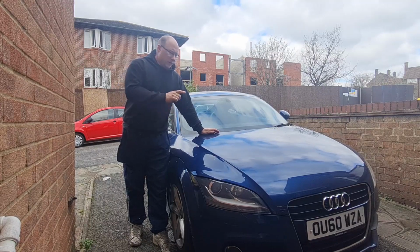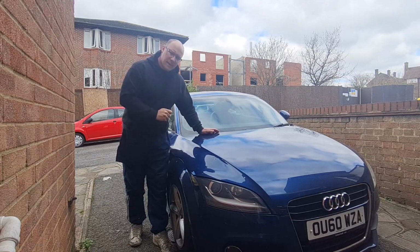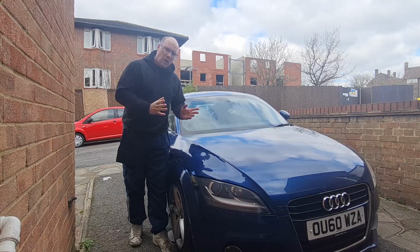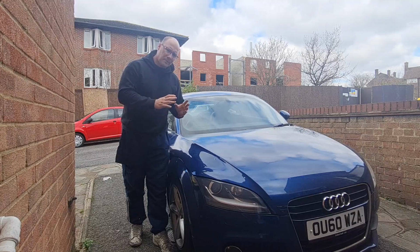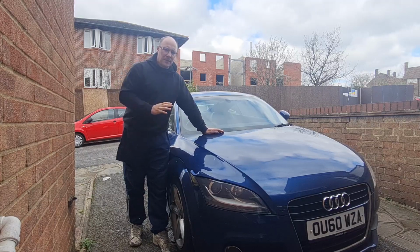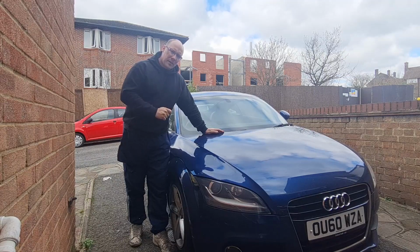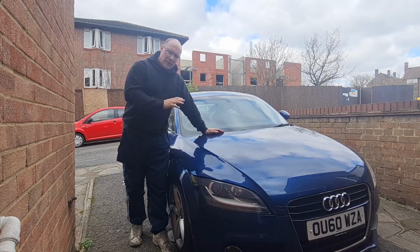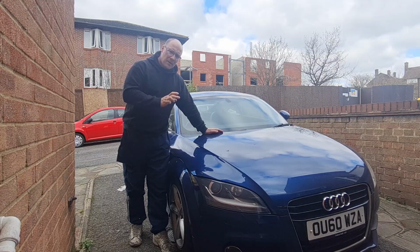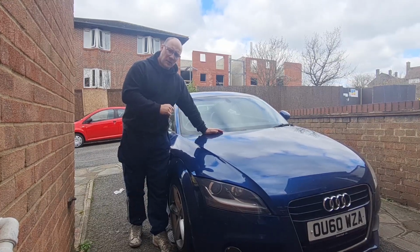Now I've had a look at it and I've actually taken the PCV valve, which is a positive crank ventilation valve, apart. I've cleaned the whole thing out and I have looked inside it. It's got a rubber diaphragm inside it, and it was all clogged up inside and the diaphragm is starting to deteriorate. Since I've cleaned it all out, I've been driving it around for a couple of days and it hasn't missed a beat since, but because that diaphragm is deteriorating, we are going to change the PCV valve on it today. We're also going to put a new rocker cover gasket on it as well.